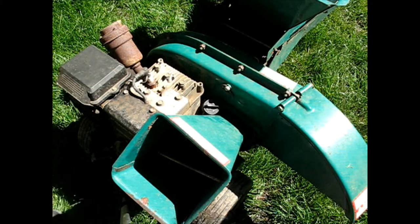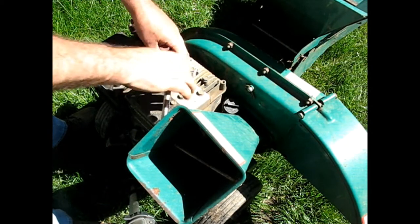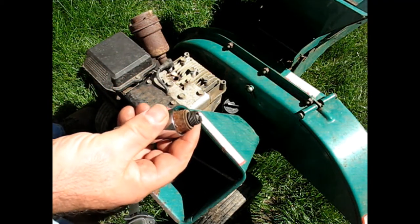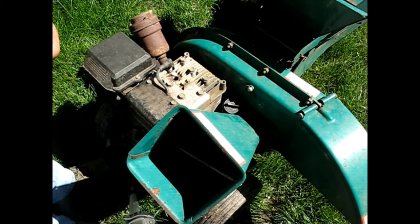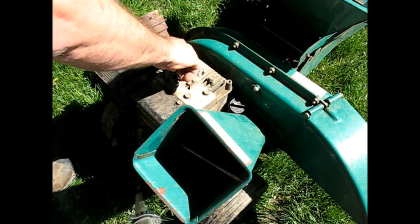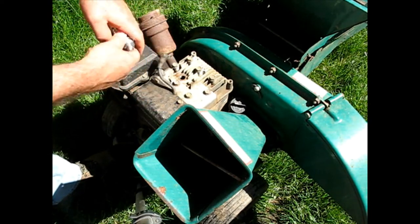The next thing I'm going to do is change that spark plug because it looks rusty. It's a classic J19LM — this is an older machine, I can tell just by the plug. The plug looks like it was burning reasonably well the last time it ran. I don't see any signs of real bad oil or anything, but I'm just going to replace it regardless. I should have blown this off before so I don't get junk in there — I'm going to put that old plug back in and blow it off first.